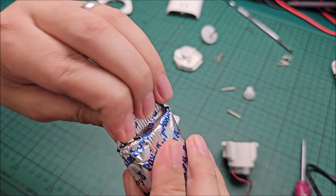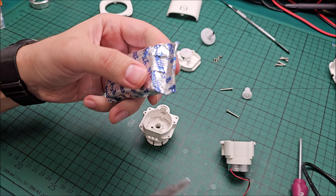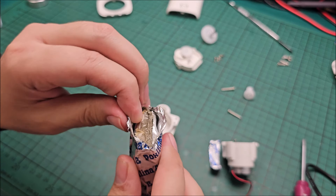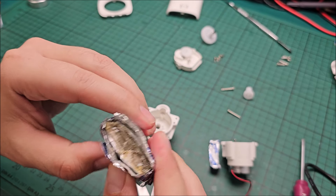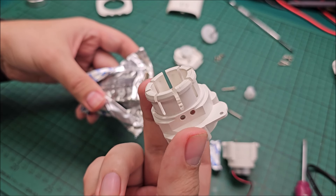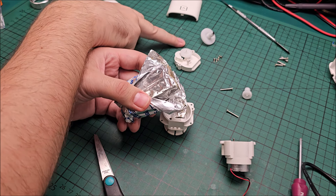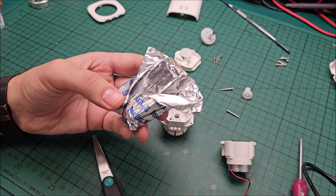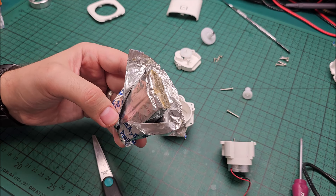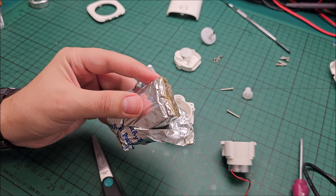This is what I'm going to use — a two-component glue. I don't think I even opened this up, so next step will be to cut it, start mixing what's in there — a tiny bit of it obviously. Hopefully it's not dried up — no, it's not. And fill where I think it should be filled, let it get strong. Final strength will take a few days most likely, probably 24 hours should be enough, but I will let it a bit more, put everything together and hope for the best.